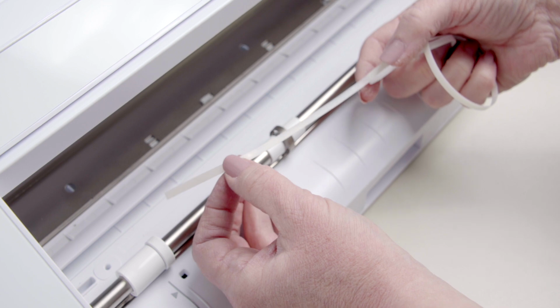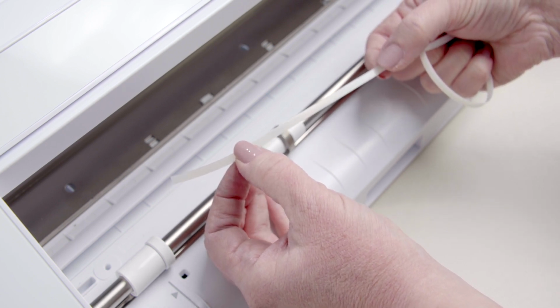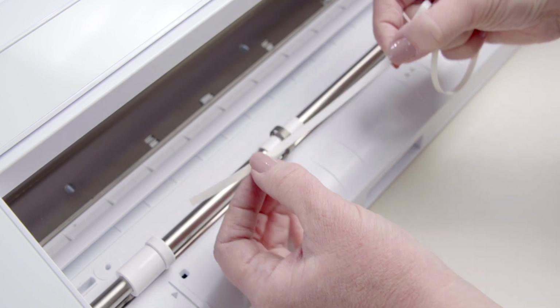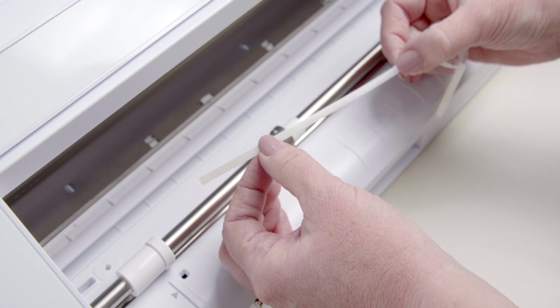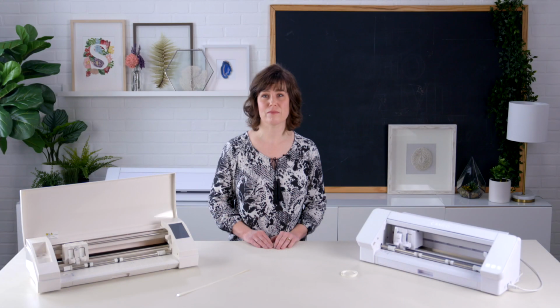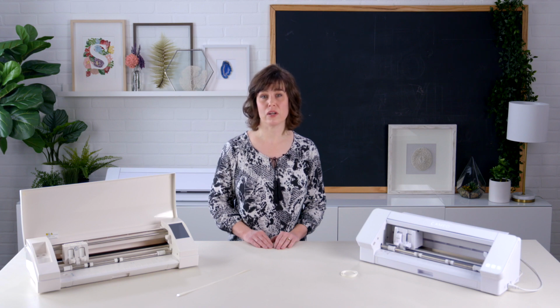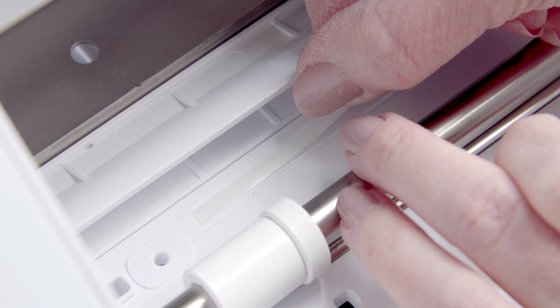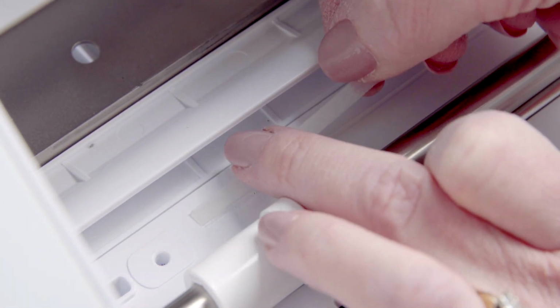Before we apply this new cutting strip, keep in mind that while adhering, you'll need to make sure that the strip lays completely flat and straight so that it fits entirely within the groove. If the cutting strip is uneven or curved, this can cause incomplete cutting results or other malfunctions. Mistakes that need to be fixed by pulling it back up and reapplying it can cause bumps to appear in the cutting strip.